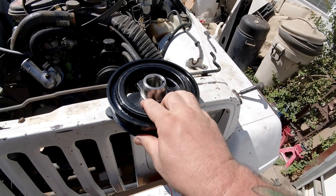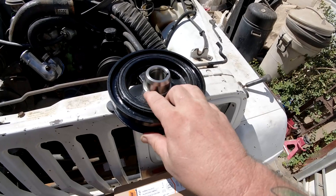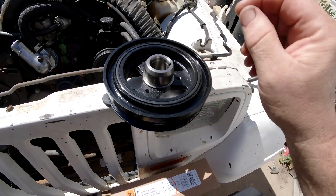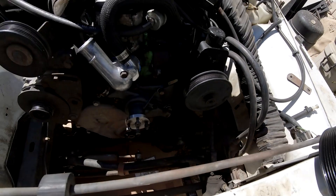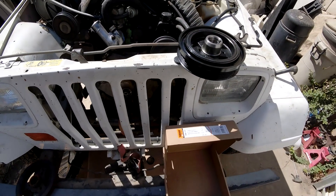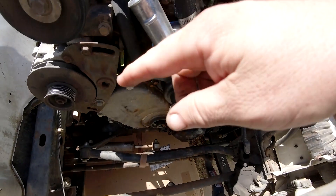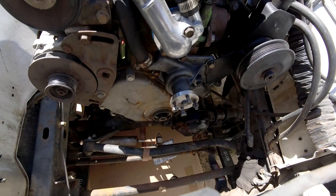From the inside race to the top is the same, but on this one the centerpiece seems to be moved back just about a quarter of an inch or in that ballpark. So I'm going to go ahead and test fit it and see how it lines up with the pulleys. If it looks close, we're going to send it — because finding a 1990 pulley that is not V-belt but ribbed is pretty much impossible. I found lots of V-belts.